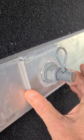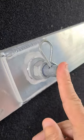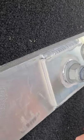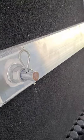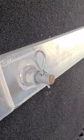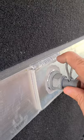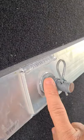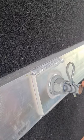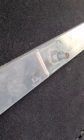On the other side you can see a plate is welded on, goes straight through with a bolt, washer, and nylock nut, then a pin — so you don't have to worry about carrying keys and padlocks that jingle around and rust. If someone puts a spanner on it the pin stops the nut from undoing; even if the nylock nut does come off, it'll only go as far as the pin.